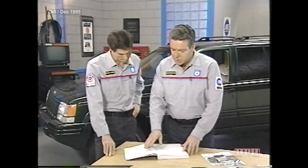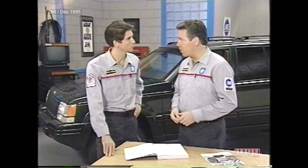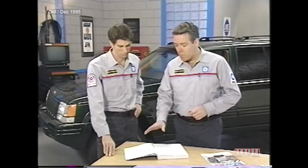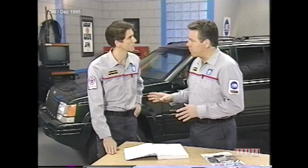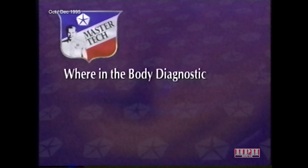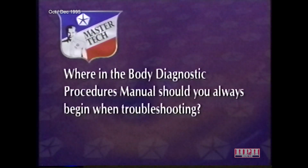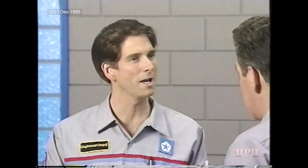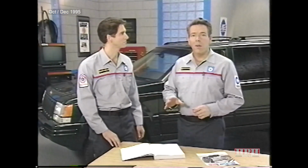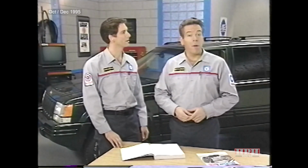The verification test ensures that you complete the last step of the 6-step troubleshooting procedure, verify operation. Now, before we move on, let me ask you a question, which I'll also direct to the audience in general. Where in the Body Diagnostic Procedures Manual should you always begin when troubleshooting? Well, that's easy. Symptom ID, test 1A. Well, it's easy, but important. Remember, if you always start at symptom ID test 1A, you're less likely to make mistakes.